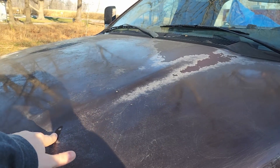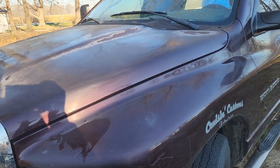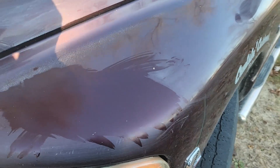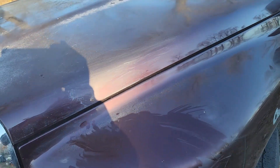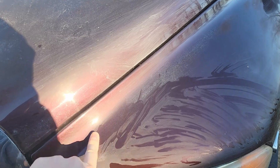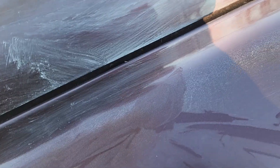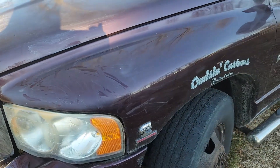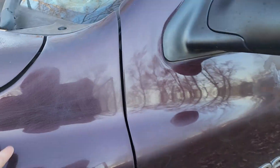Now, if you want to do paint correction, now's the time. My paint has a lot of pearl in it — it goes from a red to a maroon to a black. So I can't simply do paint correction on this color. You have to go through and repaint the whole section so you can spray those pearls back in. You can see I don't have any more blemishes in that area — this is where I sanded last night. I'll show you as we go the little points where you need to work a little harder. Those do disappear with water — you can see where it's a blemish, and when you re-spray the clear over that, those are going to disappear. Brillo pad and some water. You can block sand it too; Brillo pad's the easiest thing.